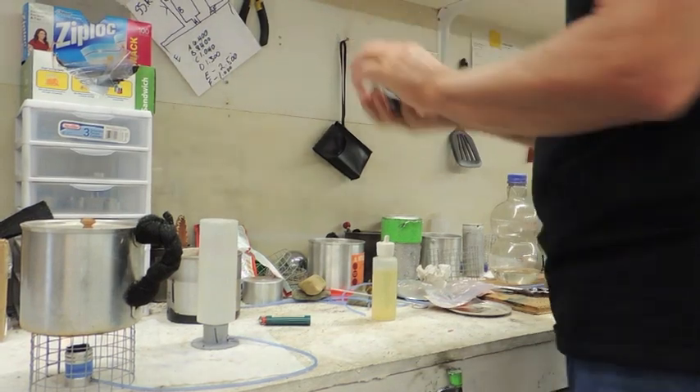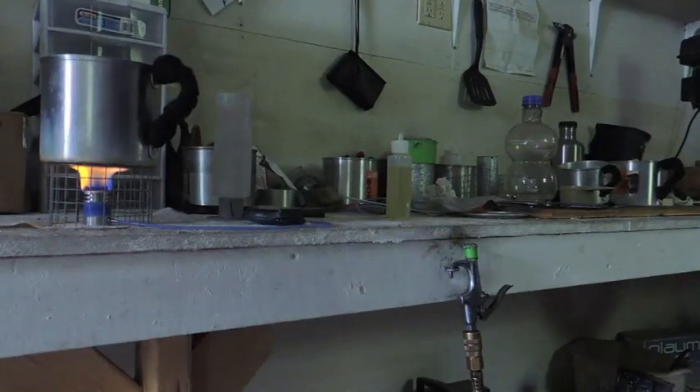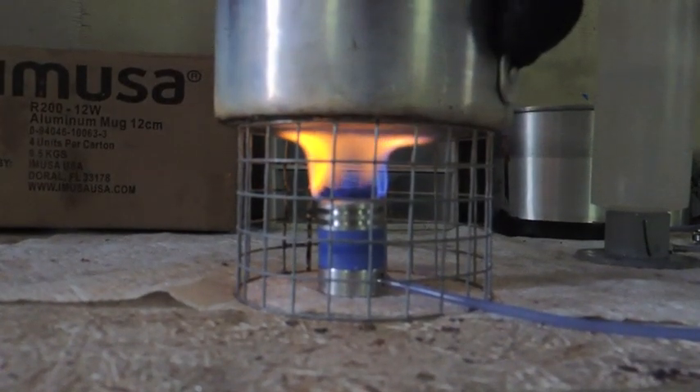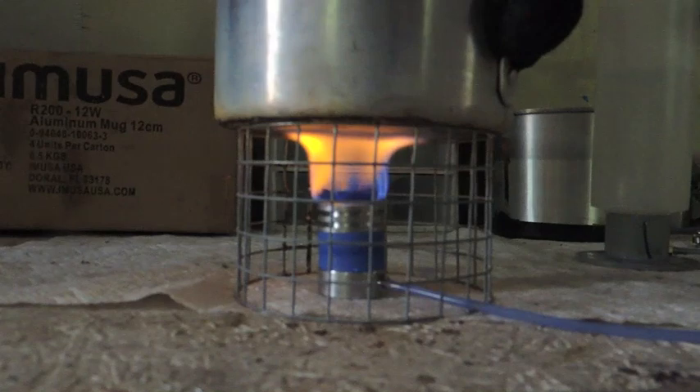Got to find my stopwatch and get it going. I've got my remote, and I've got the flame on the stove that I wanted. I'll turn the light out so we can look at that. I believe that's about what he was looking for. The wick is so low that it's burning right against the aluminum, and I think that's the reason I'm getting yellow flame. It doesn't hurt anything and doesn't seem to smut up the pan. But it is kind of yellow — that's a brand new wick. After that wick burns a while, it probably will burn blue. I'll turn the camera back on in about 25 minutes and we'll run a test to see if it's cooked or not.